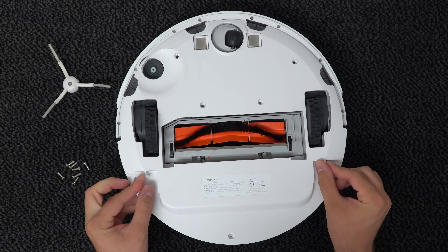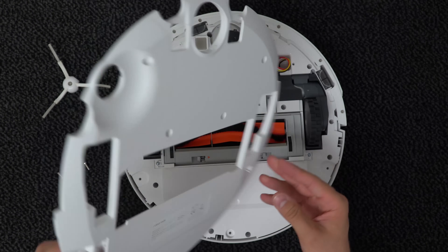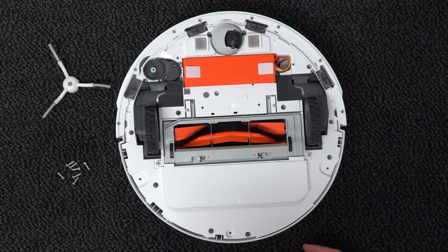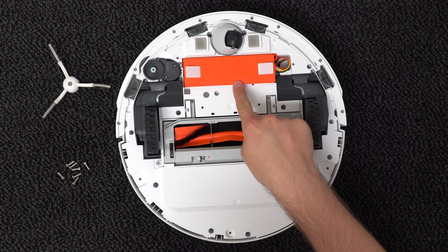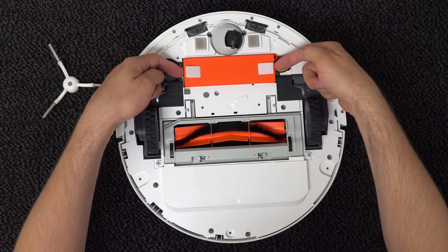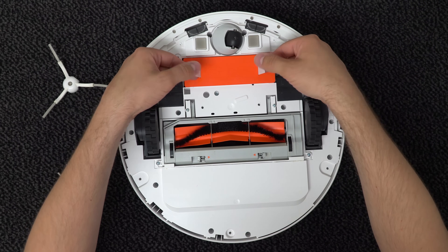When you're done, you just carefully lift up the back cover and move it to the side. And here you can see the battery, which is connected to the motherboard on the right side. Use these two straps to lift the battery out.